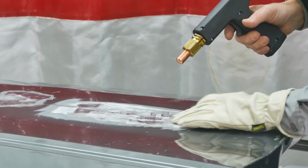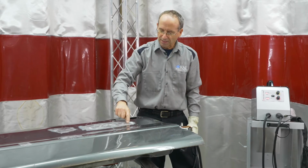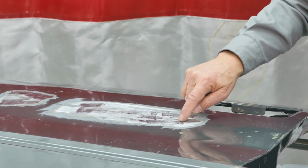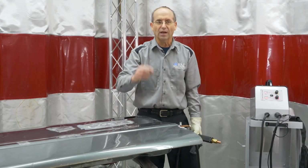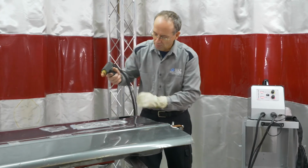And what that does is starts taking off that little crown of that point sticking up. If you try and tap that down with a hammer or with a punch right on the center, what you end up doing is shrinking, or is kicking the whole area down. This will actually take that little high spot, that little bit of heat on there, that little bit of pressure, and it'll actually shrink that point right down to a flat spot again. So real nice on this.